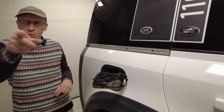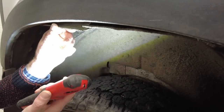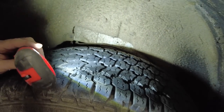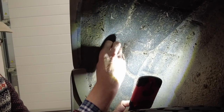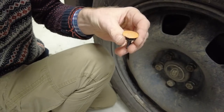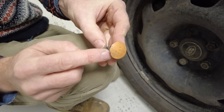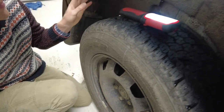We'll lose our air tag cavity but we'll find another one. Let's get on - dive under here. We have got the wheel arch liner half out. We're going to pull a couple of poppers - there's one at the back, one of those two-part poppers where you get the middle bit out first. There's one around the side as well. This one is annoying because it's a two-part popper but the head covers the rim, so you end up trying to pull the whole lot out.